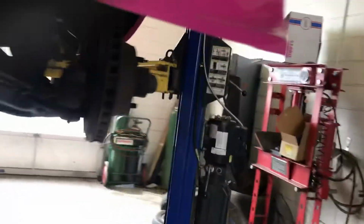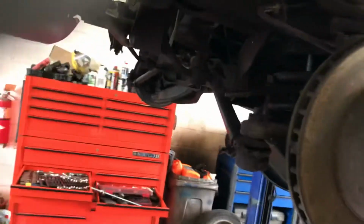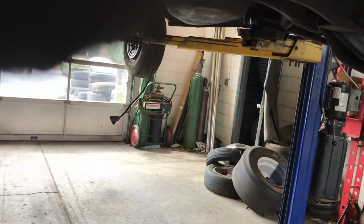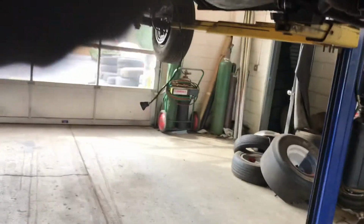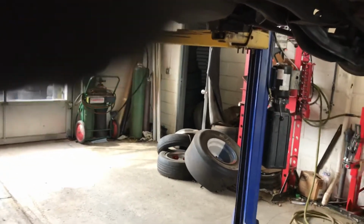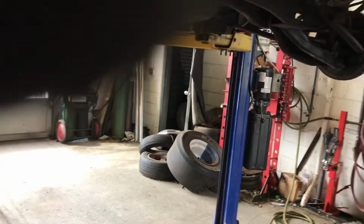This van's called Vanther. It's a '77 B200. I have a 440 at the machine shop right now being built. All the machine work is done, and it's going to have Edelbrock aluminum heads, a Hughes Whiplash cam. The compression is going to be 9.5 to 1. Ceramic coated headers, 770 carburetor, everything.